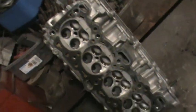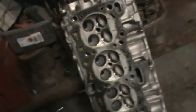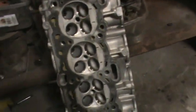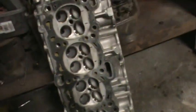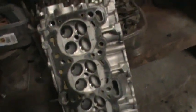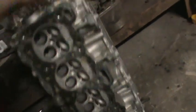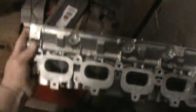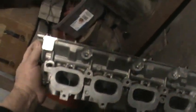Core drilling releases pressure off the guide - when you make it thinner, the guide collapses on itself as you push it out, so you don't compromise the material around the guide. We're putting 12 new valve guides in, picking those up and starting Monday. It had a really nice valve job on it already, but we're going to do the valve job again, some port work, get some Ferrea stainless steel valves and new springs because the owner wants to put a little more camshaft in it. We'll get the installed heights set up, CC the combustion chambers, and get everything flowing well.